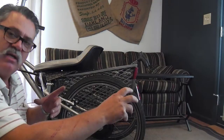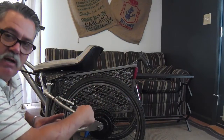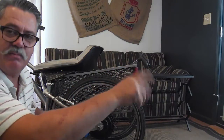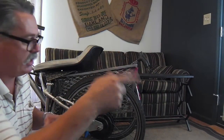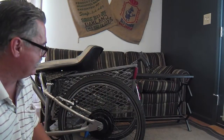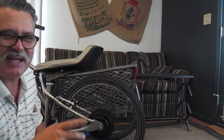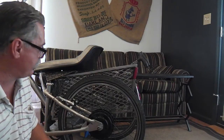With a mid-drive, that is the motor that connects to a chain and a sprocket somewhere, the sprocket can have the freewheeling action itself. So you don't have a weak link inside the motor hub, because the freewheeling action can be done very simply by a one-way or a freewheeling sprocket. Very simple, cheap mechanism that can be installed on any axle. I've got another trike, off-the-shelf adult trike, and I'm kind of thinking about maybe experimenting in that direction with just a chain-driven motor.